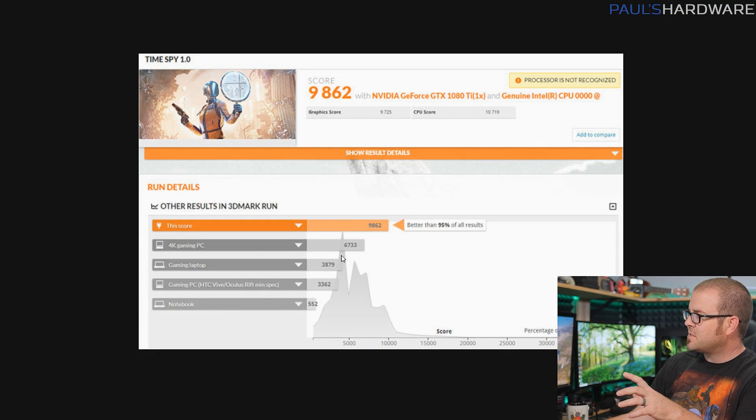Where I'd point you is synthetic benchmarks. Take the games you play and try to find a diverse array of reviews that tested that game with your hardware. But I'd recommend 3DMark because it has multiple tests covering DirectX 11, DirectX 12, VR, and ray tracing. You can download most basic tests for free. They give you a run details sheet showing your performance alongside comparable systems, so you can see if something is holding your system back or if you're within the expected range. From there, minor things like a small overclock, memory settings tweaks, or double-checking game settings can help.